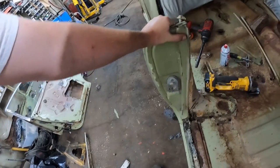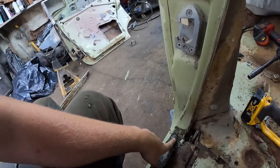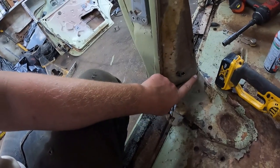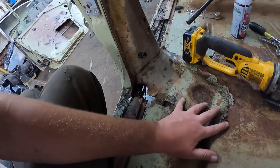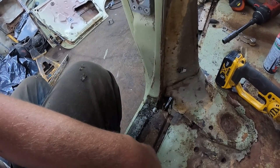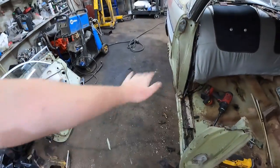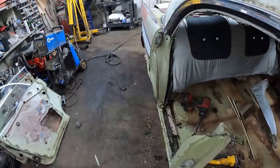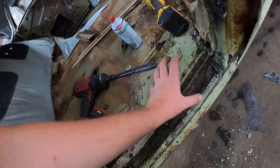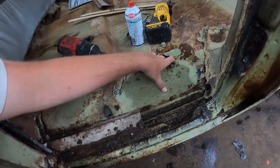This is the post now. The post has some wiggle to it. The way it works: it attaches to the rocker just like any other thing would, but has this kind of brace which goes over into the floor. You can see where it's kind of bracing — well, there isn't a whole lot left to it anymore, so it's got some flex. The back door was hanging and I had to lift it to latch it, so I cleaned up a little bit. I just took this little plate off — it's actually fairly solid here and the floor is nice and solid here.